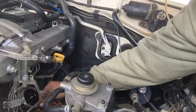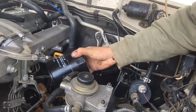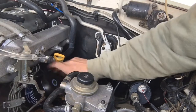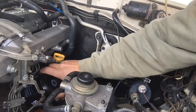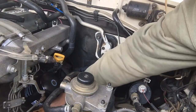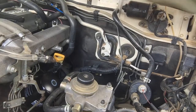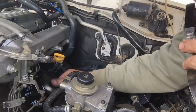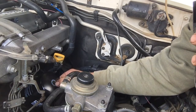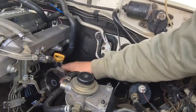And going to add that filter housing now. Slip it in there. Oil filter onto the housing. And there we're tightening now. I'm just going to take this rag out now because she's done its job. And I can see that this is facing up towards me. It says 19 there. And so what I'm going to do is I'm going to spin it round till it comes back.